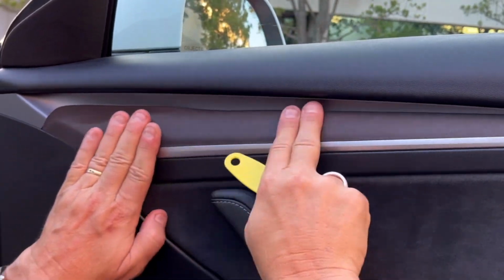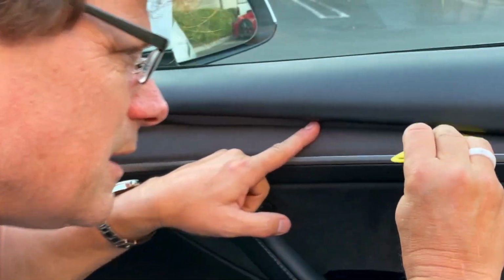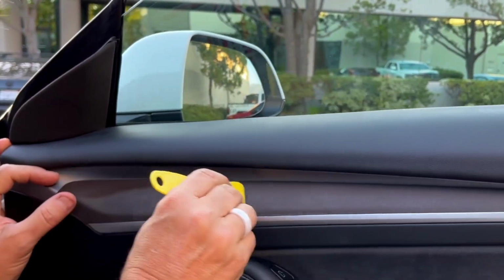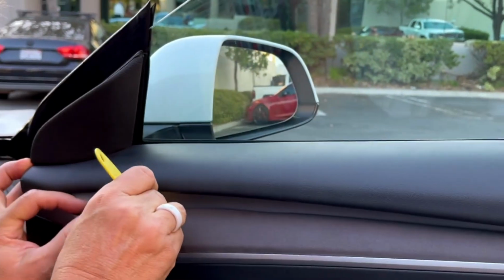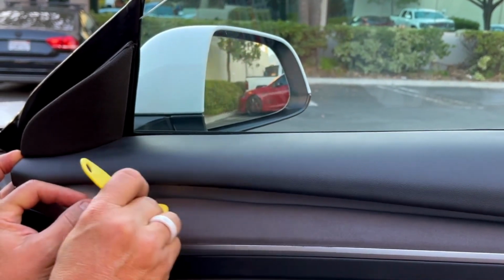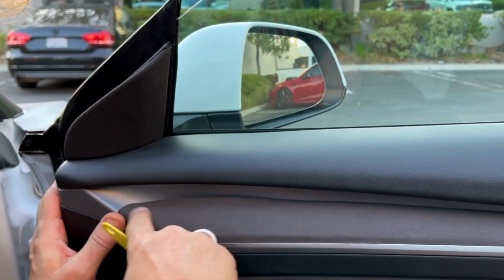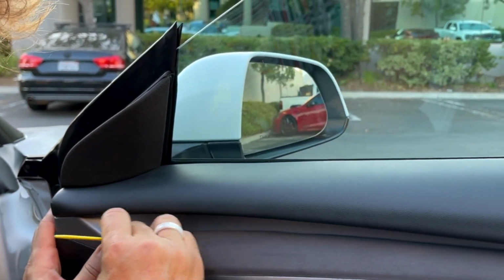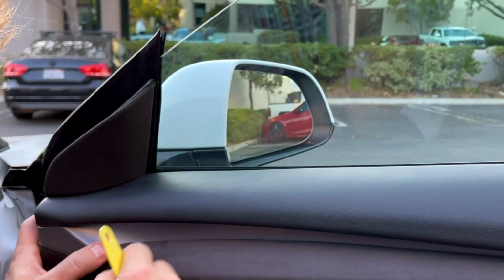Now I'll move to the top. Get a good high angle. This looks great, all tucked in, just wide enough to wrap all the way over. Now, watch this, squeegee. Bend the squeegee like this, bend it and push it to get all the air out, while you hold your hand here, because this area here is stretched. Now I keep going and going. Fingers over the top.